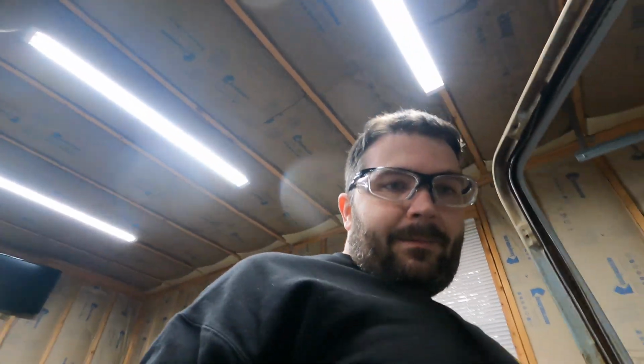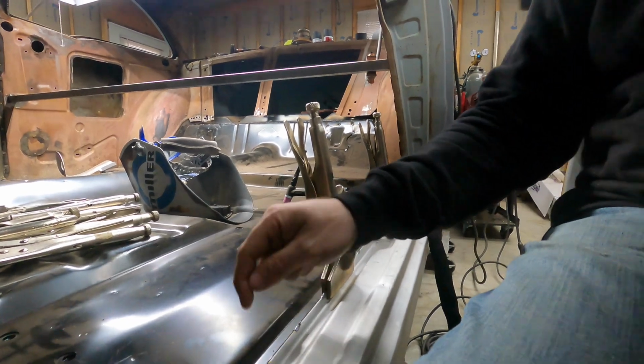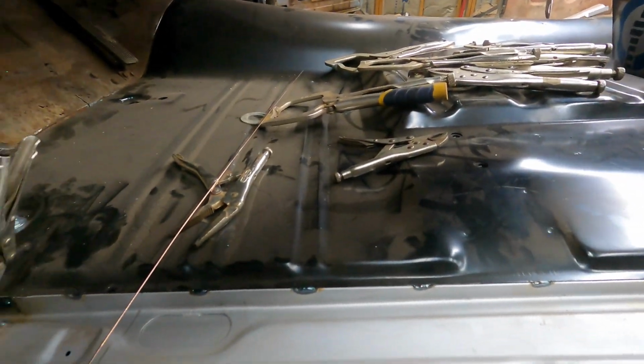Because with the wire welder, it fills up the metal so fast that you don't get as much time to penetrate. So a larger hole actually allows you to work your way around and fill up the little rosette. But with the TIG, you don't have to do it quite so much because you can fill it over quick and then burn it in, get it to suck in. But anyway, either way, you have the ability to do it.